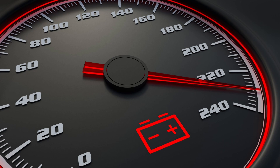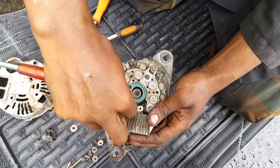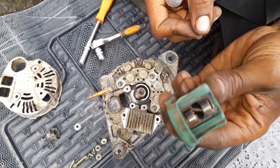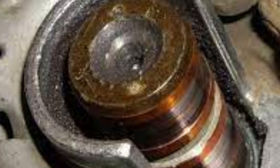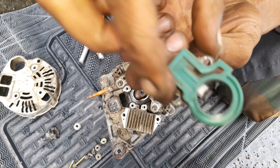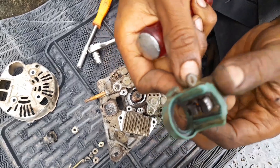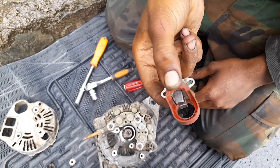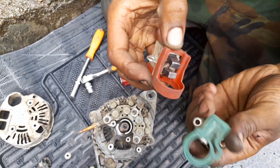If you find your car battery is not charging, or the battery warning light on your dashboard stays on once you've started your car, it's possible that your alternator brushes are bad. Alternator brushes provide power directly to the field coil through slip rings. These graphite brushes are designed to last more than 120,000 miles. If these brushes are worn, the battery in a car or truck may not charge, or the battery warning light may remain illuminated after the engine starts.